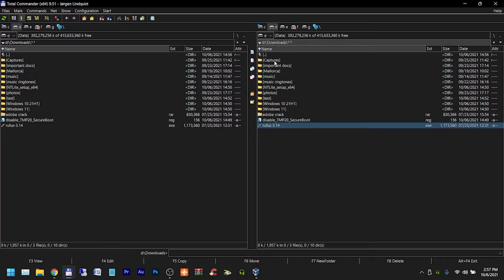First of all, if you want to install on a modern CPU with Secure Boot, UEFI and TPM, there's no problem. You can make an upgrade from an ISO file, or you can make an upgrade from Windows Update, or you can make a clean install from your flash drive. Everyone knows how to make a bootable flash drive for UEFI, how to make one for legacy BIOS, because we are friendly with Rufus, but we need to make a special ISO file first to be able to make the installation on all the CPUs, which was tested by me.